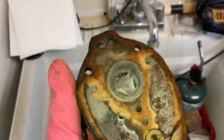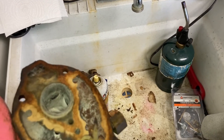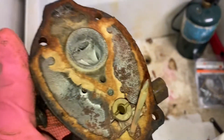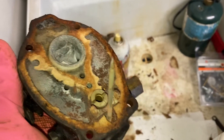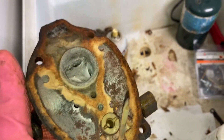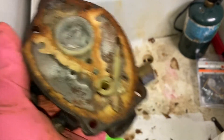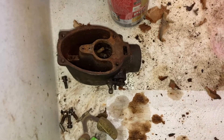I have to get the gasket material off this top part. I'm going to clean this up. Usually what I do is just take an old blade and go through it. Once I get a lot of it off, I'll wet it down — usually with degreaser or carb cleaner, whatever I have laying around — and scrape the rest off. I got the bottom part pretty good.